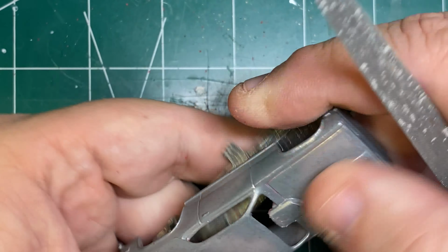One important thing to remember is if you're going to use the leveling thinner in any of your paints, basically what the leveling thinner does is it slows down the drying process, which means you might normally think that the car would be dry and ready to handle at a certain point. It might not in this case. It's going to slow down the drying process so that the paint has time to flow out and flatten out and become very nice and smooth.